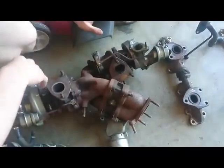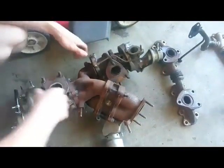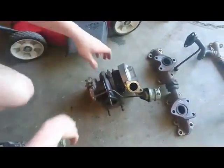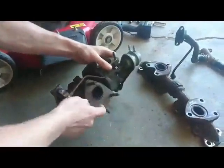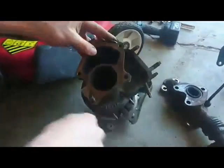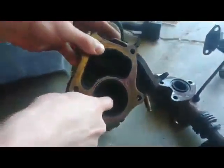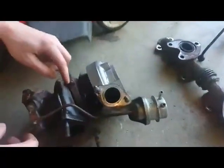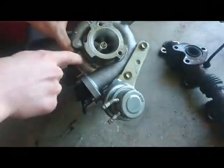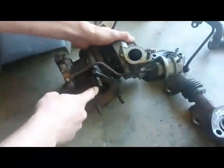First things first, this is a stock twin turbo and what I've done is separated one of the turbos. If you're not a car person, essentially what happens is exhaust pressure goes in and around this little snail-shaped object, spinning a wheel — there's a fan blade in there — and then that is connected via a center shaft to the front fan blade, where air gets sucked in, spun around, compressed, and shot out of this little hole here.